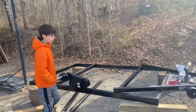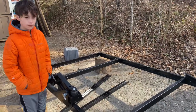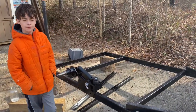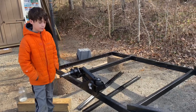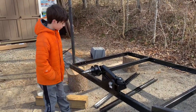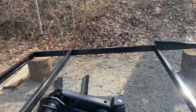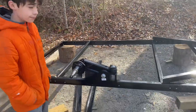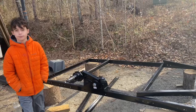One other thing to mention with this IronTon utility trailer: some of the cross members, particularly right in the center, have bolts that stick up since it all bolts together, so I had to remove those to allow the axle itself to rest flush to the frame. When we put it back together, we won't be putting those bolts back in on the bottom. We will be inserting a 2x3 inch steel tube per Timbren's recommendation through this section, which helps strengthen the trailer and provides additional support for the axle.